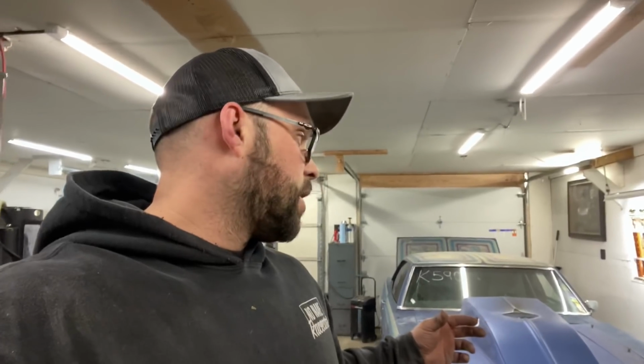So if you're wondering, yes, the car is supposed to be on methanol. That was the plan the whole time. It is on 85 right now. Reason being is I want to bring it down to Steven's, put it on the dyno on 85, and then make the switch to methanol. We've done that before, like a pre and post results type of deal, but I just don't want to dive right into the high compression methanol because, like I said, no O2 sensors. Kind of thinking about getting some EGTs before I go, but we'll have to see how the old piggy bank goes. So stand by.